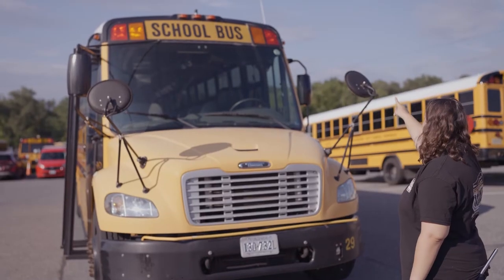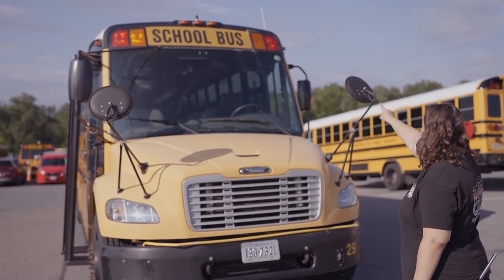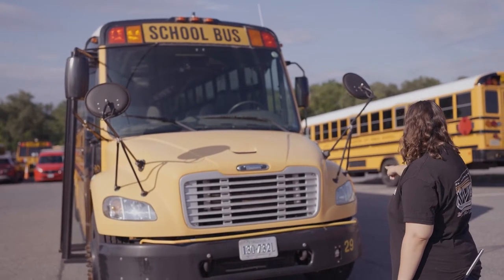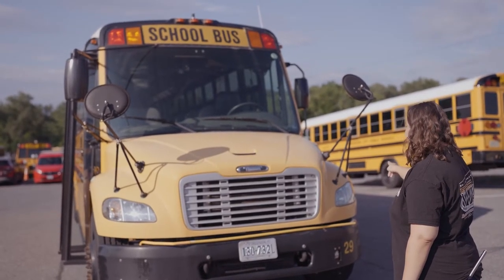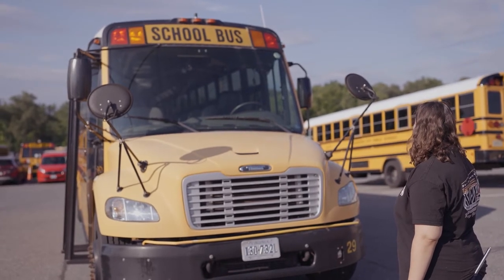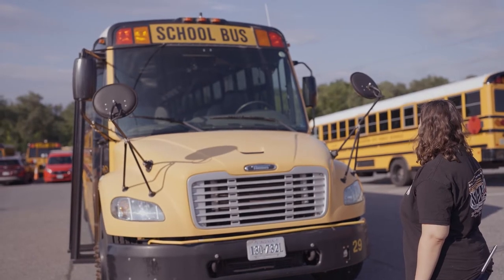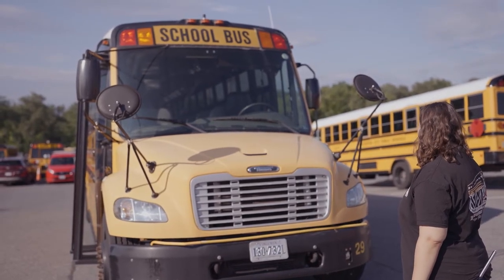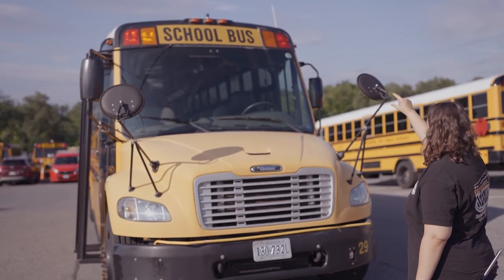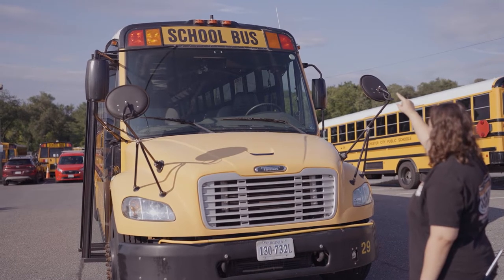I have 5 amber clearance lights, 2 red loading lights, 2 amber warning lights, 2 clear high beam and low beam headlight assemblies with amber turn signals. They're all not discolored or faded, not chipped, cracked, or broken. The seals are not worn, torn, or frayed. It's not missing any nuts, bolts, or screws. And they're securely mounted. My 8-inch school bus lettering reflective tape is clear and visible. It's not worn, torn, frayed, or burnt.